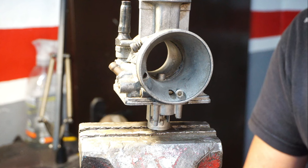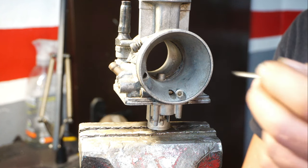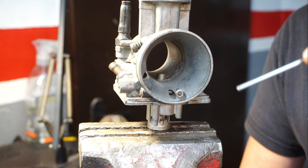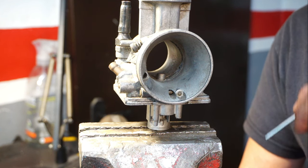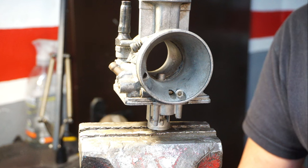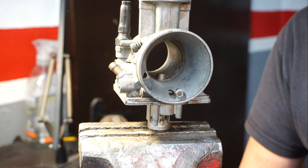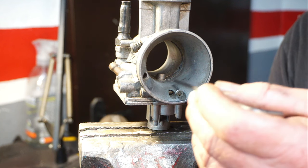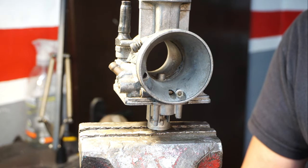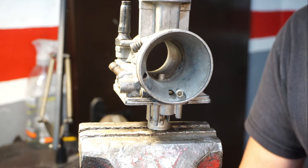Coming to the fuel supply that's needed for a stoichiometric engine, which means the perfect mixture, is between one part petrol and 14 parts air, and one part petrol and 15 parts air, about 14.7, but between 14 and 15 is about right. You don't want it too rich, you don't want it too weak. If you can get it round about there, that's a stoichiometric volume of fuel and air mixture, and that gives you perfect carburation. You want to maintain that all the way from the low end up to full throttle. And getting that is very, very complicated.